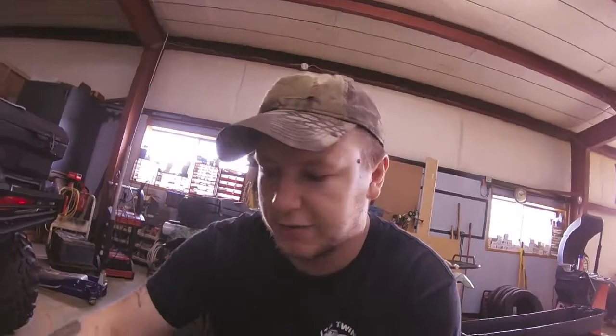If you torque them down too much, if you just ram the gun and hold it tight, it'll pull the inserts up out of the plastic or the polyethylene or whatever the stuff's made out of. So that's another thing they say, and I would recommend, if you don't have an impact or a power tool where you can turn the torque down, then I would just tighten everything by hand.